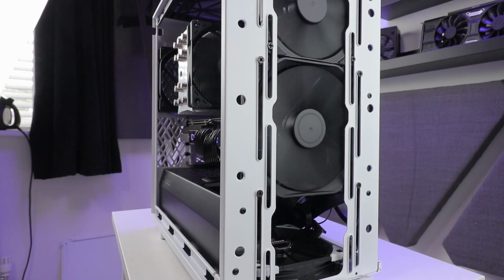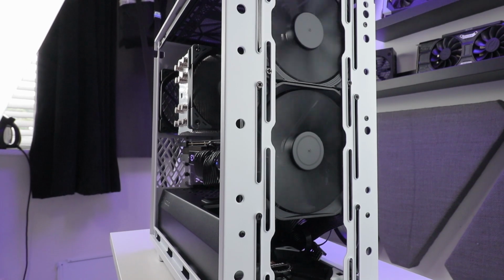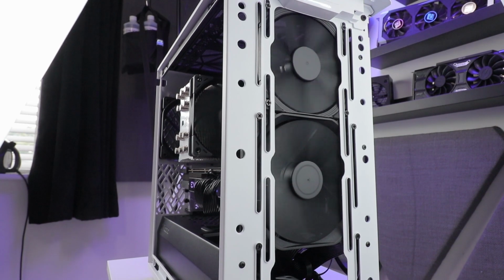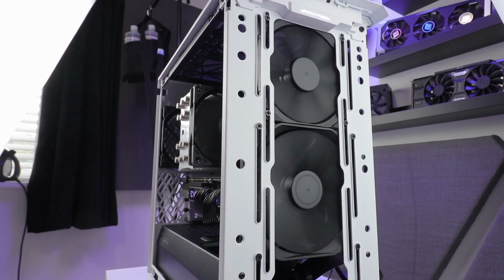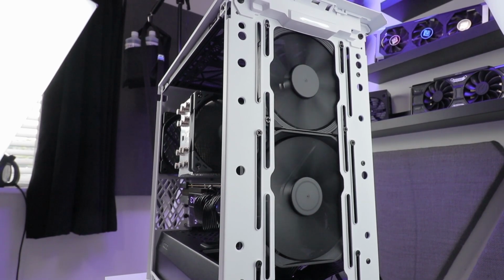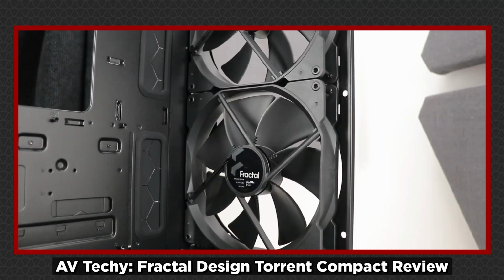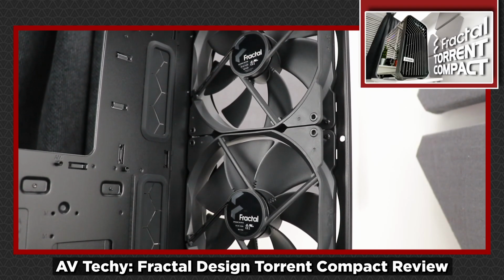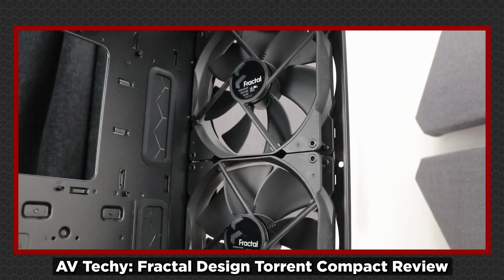Instead, to perform the acoustically limited testing, I've created a few setups that we just discussed with additional test fans which provide some noise overhead. So all case fans could be limited to hit the acoustic target, and then we can compare to others in an acoustically normalized fashion. Other cases that come with louder fans or more case fans don't always need additional case fans to meet the acoustic target, but sometimes I'll add in a case fan here or there just to test out different setups and things like that, so it's not all strictly about the noise of the stock fans.